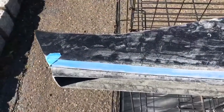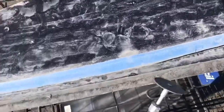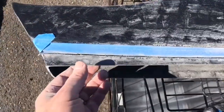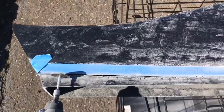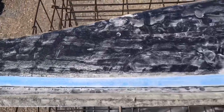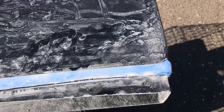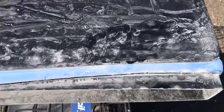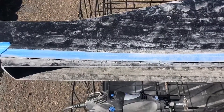We've taken the work outside - this is a dirty, dusty job. The cutting wheel on the Dremel really cuts through fiberglass like butter. I do basically one width of the wheel at a time and hold it steady. I definitely recommend wearing a respirator - there's a lot of fiberglass dust you don't want to breathe in. Protect yourself when working with this material.